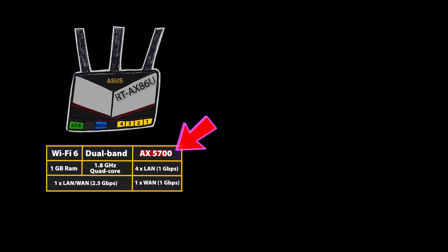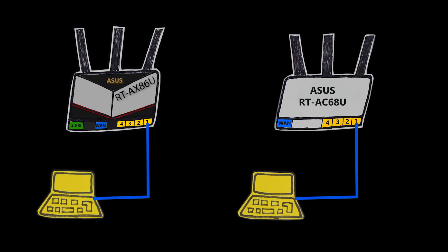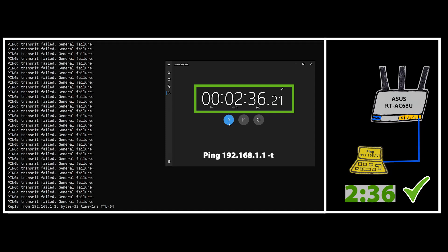We already talked about Wi-Fi speed, but I should also mention that one advantage of having a super fast processor — apart from being able to do a lot of tasks simultaneously without getting overloaded — is that the router can also boot up much faster. To better understand that, I again compared it with the AC68U. In this test, a computer was directly connected to one of the LAN ports of each router and was continuously pinging the router. I wanted to see, from the moment I powered on each router, how long it would take for them to respond to those pings.